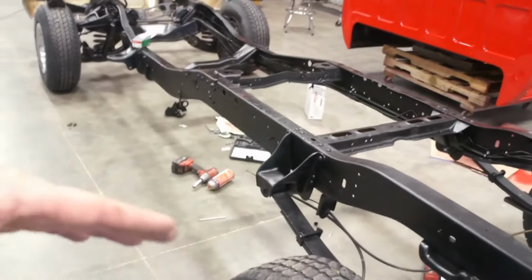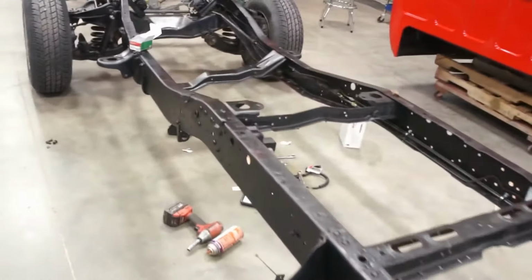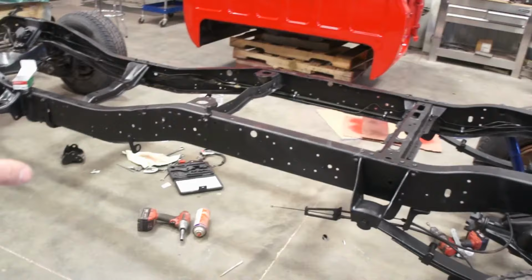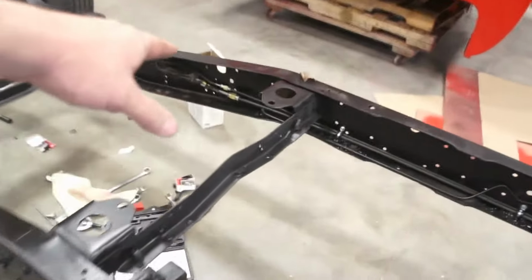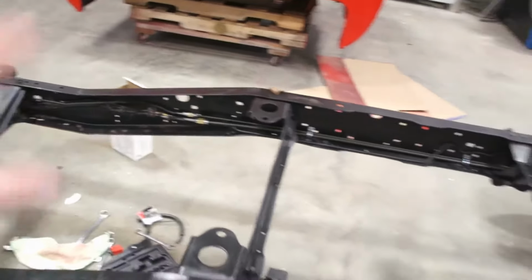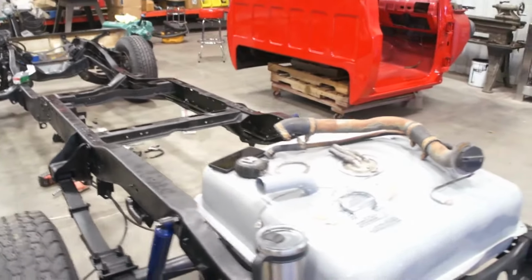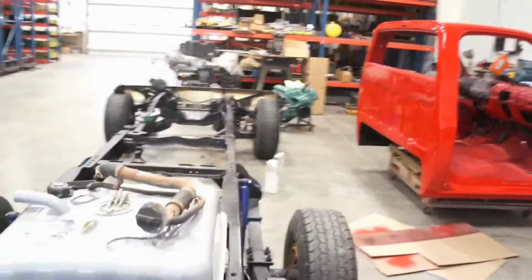These were lined with the plastic covers underneath. Dirt, sand, whatever else, vegetation, small animals have built up between the steel tank and the plastic liner, and rotted pinholes through the bottom of the tanks. So I had to replace tanks. The selector switch, left to right, which would have been located right here, all the electronics and fuel lines right in here, those are known for going bad on a guy. When I parked this truck, everything was still working. I mean, it sounded vaguely like Man of War going through a wood chipper, but you get the point. It was gravelly, loud and crunchy and whatever.